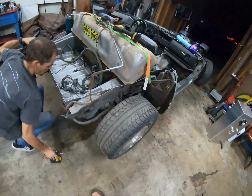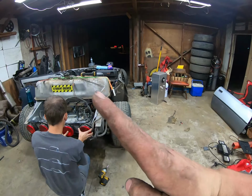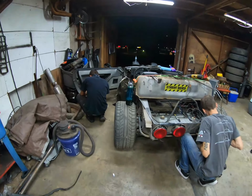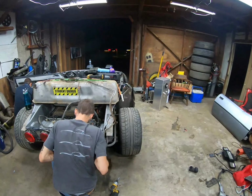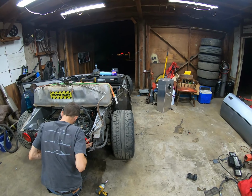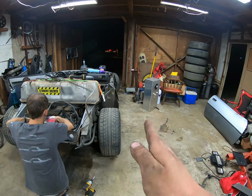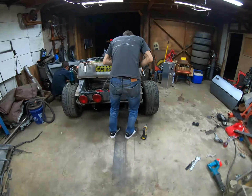I think I got the camber on this wheel fixed. Now that I could see the wheel, it was like when we pulled in here. Pulled some of the camber out. Oh, this one's got quite a bit too. It's like that tire's going straight now. It was toed out and leaned in. It's toed out a little bit, but needs to be.